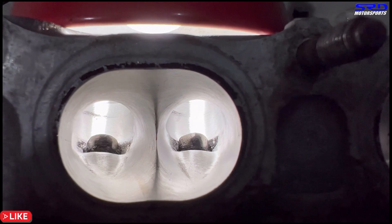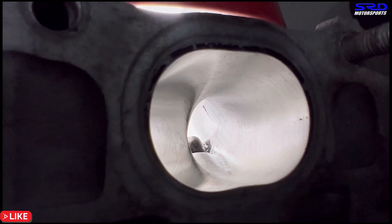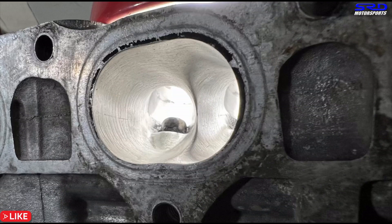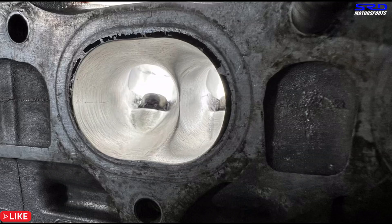You can see the ridge before the valve seat is still there — we didn't hog that out because we're trying to streamline this, not enlarge it so much that we lose torque. Looking at the picture, the contours show you the consistency of the exhaust port. From the divider to the port wall to the bowl, this is going to be really good. This is how we do the exhaust ports on all B16 and even D series engines.